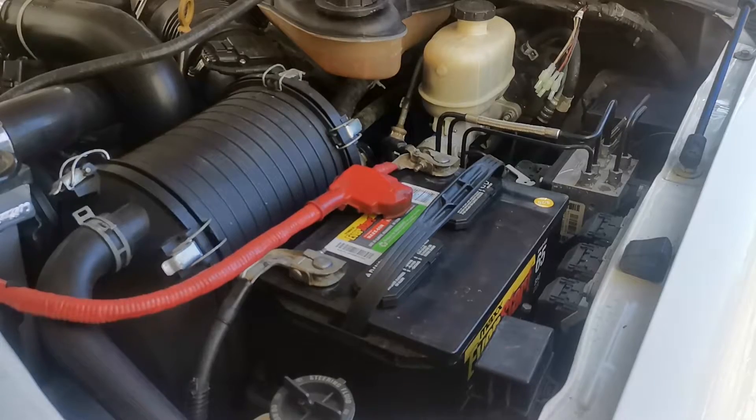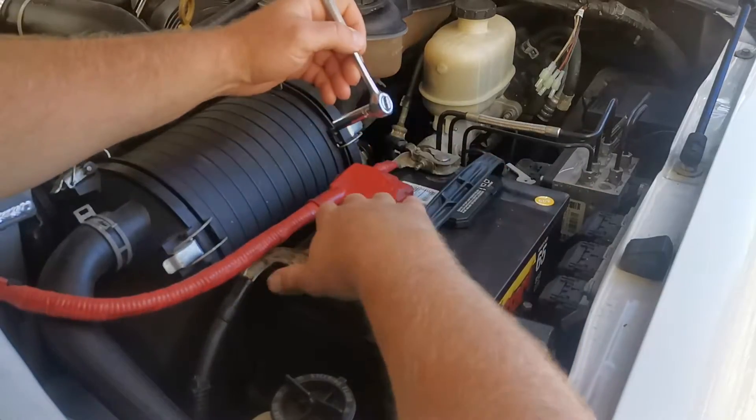I'm going to pull the battery out, and I'll probably have to take the PCM off or at least get the harnesses far enough out that I can find the dark blue wire. I'll make the connection there and then try to find an organized place to go through the firewall. I've got a little roll of blue wire here to match and we'll get on with it.